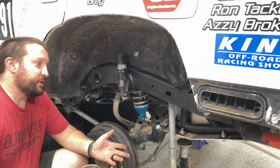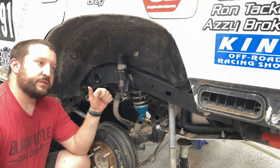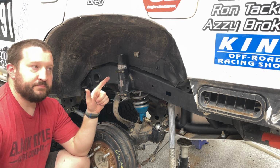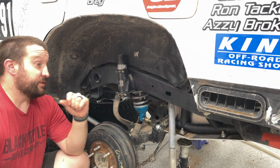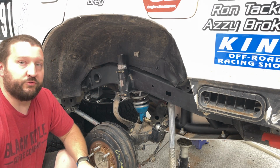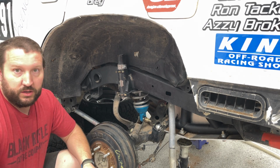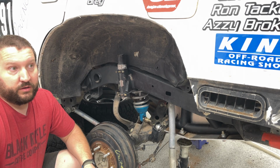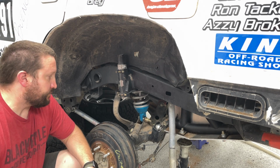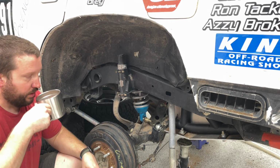What are some of the biggest limitations of this truck? The wheelbase, and then the suspension setup. The truck is set up as a double wishbone suspension in the front. It is 4-wheel drive. I want to maintain that, so I can't just throw super fancy long arms on there that are outside of the regular realm of long travel arms, because they all have to match the same mounting points to make the 4-wheel drive work.